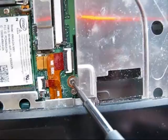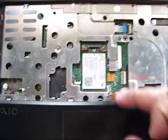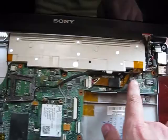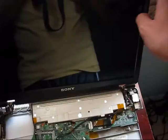In this laptop there is a huge amount of hidden bolts. Disconnect those cables using the flat screwdriver. This is the touchpad and the mouse, both of them. The cover is almost removed. Disconnect this cable and this one, pull it away. Here you can see a huge amount of dust everywhere. Use alcohol-based wipes to clean everything. We can see the LVDS cable which goes from the LCD screen to the motherboard, right there.